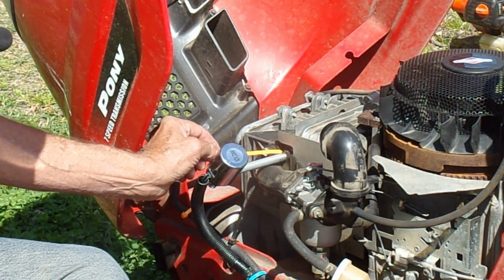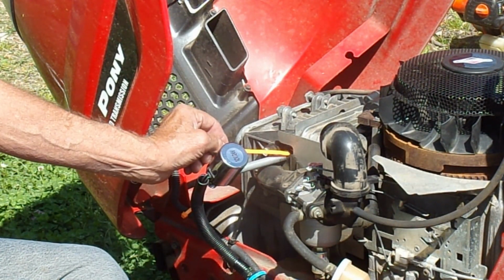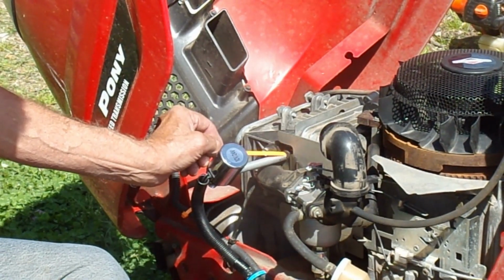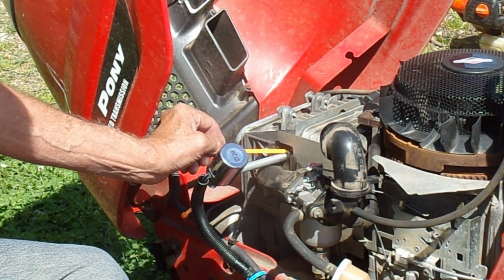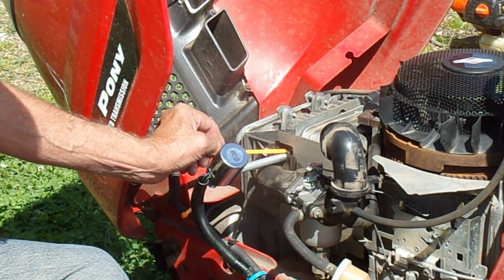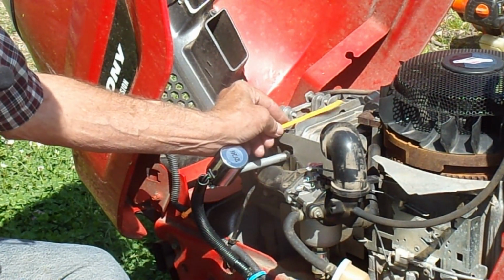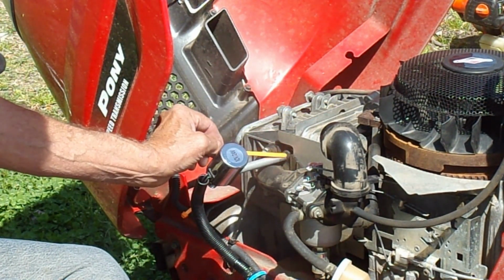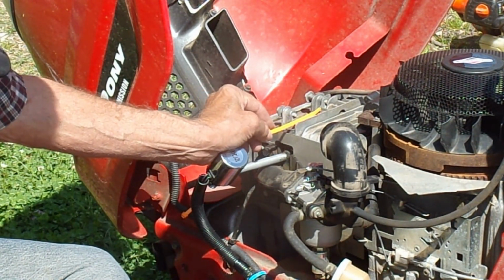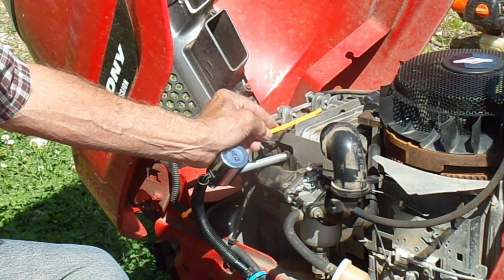Okay, and then on the side of the cylinder head where this pipe is, there's kind of a boss up here. What I did, I took a carbide burr and flattened it out what I could, and then I center punched it. You've got to eyeball it. Then I drilled a 1/8 hole to get started. Your 1/8 drill normally isn't going to be long enough to go in, but you can step it up. Get a pilot hole in there, and go ahead and drill to your tap drill size for your 1/8 pipe.